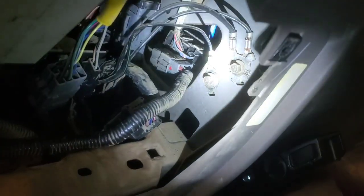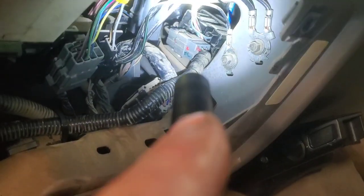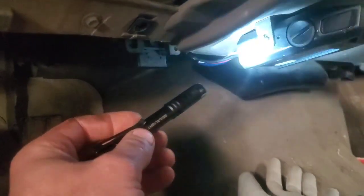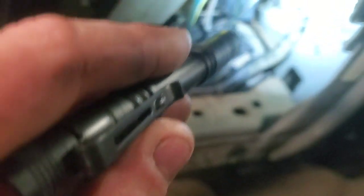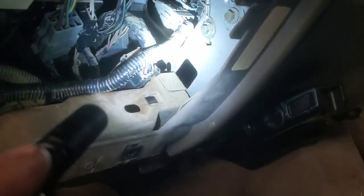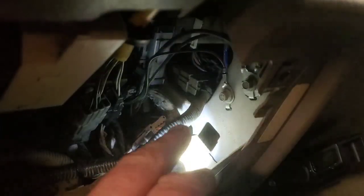With the fuse panel removed, right back there — the light's so bright with the camera — this is the connector we're pointing at right here, the one in the very front. It's a six-prong plug with four wires in it. This wire runs down and loops, since there was extra, and then it runs into the brake controller itself. Depending on your brand and model of brake controller, wherever you buy it — trailer places, auto parts stores — they've got the right adapter that will plug into that connector and then connect to the plug on the trailer brake controller.